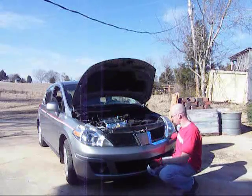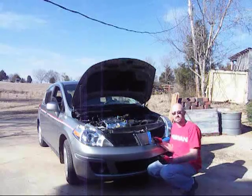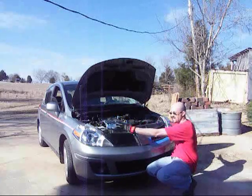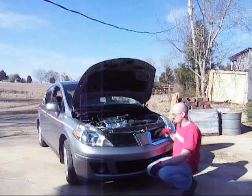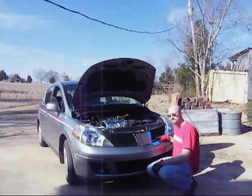Once you do your drill here, I'm going to use the packaging paper that came with the product in the box. Just recycle it. I'm going to use painter's tape and cover this all up and the fascia and the headlights up. That way when I spray, I'm not going to get a lot of overspray everywhere else. Once I get it all taped up, masked off, and start painting, I'll see you right back here.